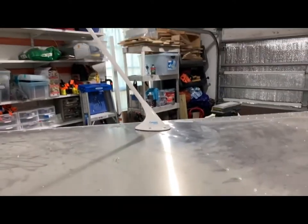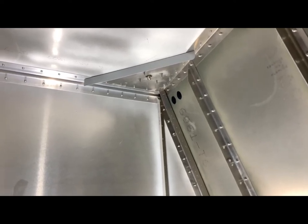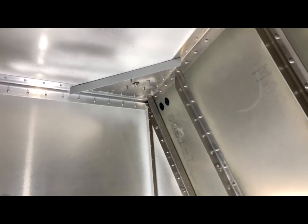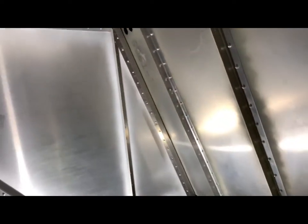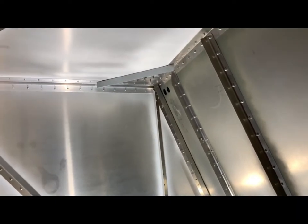Got the comm antenna all holes drilled and it's straight to the fuselage for the most part. I just need to get my washers and nuts on there - I'm going to wait till my wife gets home so we can double-team that. I need to figure out the exact length for my antenna wire. I've got the one going down to the radio way down there, and I have a little excess cable but I haven't put the end on it yet, so I'll be trimming it and fine-tuning it, then building some supports along the side of the fuselage.